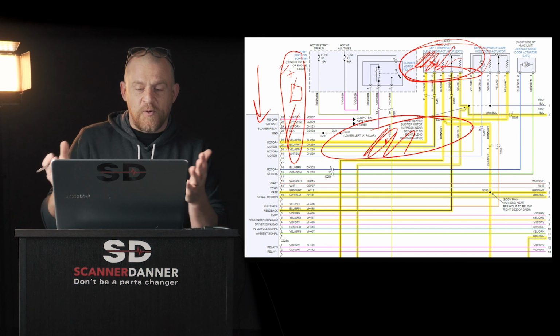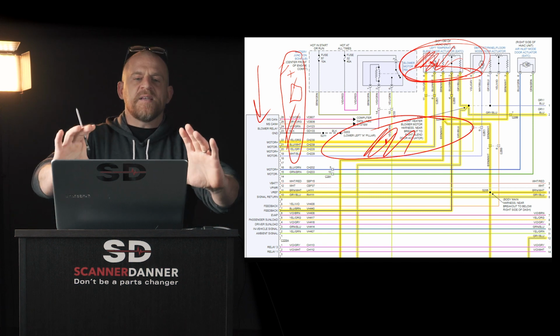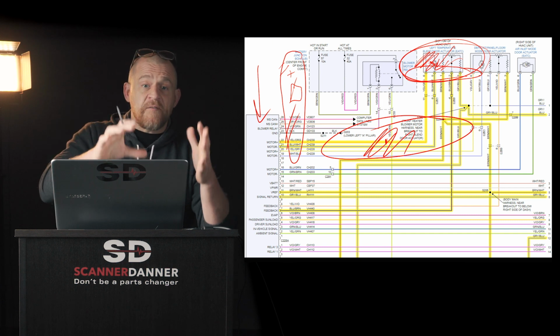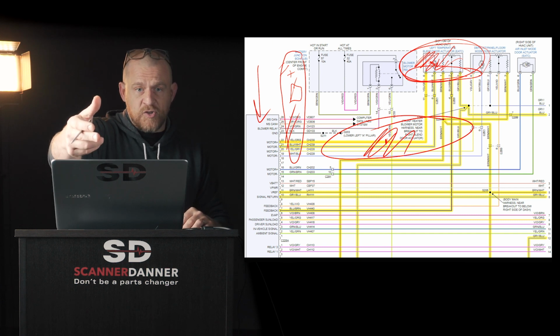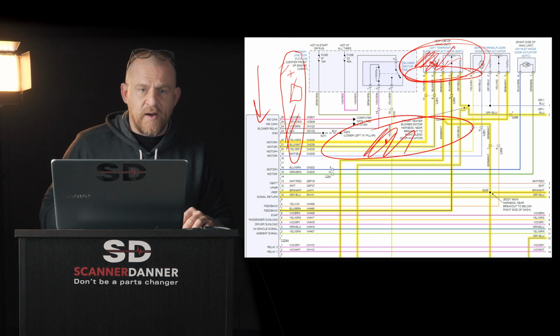So really, from this point, Caleb, we really don't have to go any further. That's the final piece that I believe should have been done by us to make sure that that driver was functional before making that call. What did we do? We kind of rolled the dice. We kind of went with common problems. We did some deductive reasoning. We said to ourselves that the rest of the mode doors work. This one is not. We have a position, but it's not moving.